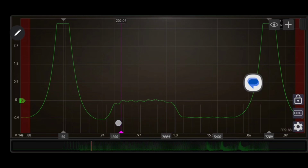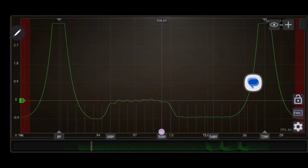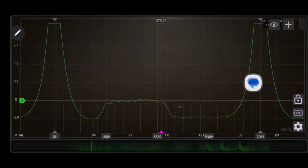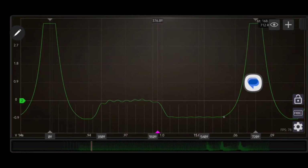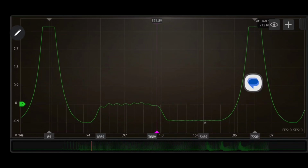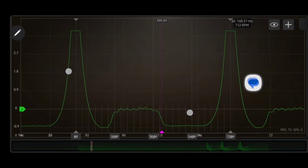Yes, so that would be retarded on the exhaust cam also, and our intake cam is retarded also, which is what is moving this top dead center line this way to the left, because our intake cam is actually spun to the right, which is retarded. If it opened sooner it would move this over here, and it would also move the rise of the intake valve shutting more towards the bottom dead center line over here, which in turn is going to make this whole entire valley shift to the left, which will advance it, because right now it is retarded. So that's a sign on there.